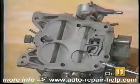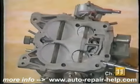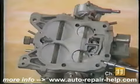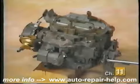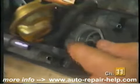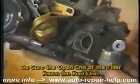Reinstall the idle mixture screws. Turn them all the way in and then back them out the same number of revolutions as counted when they were originally removed. Reinstall the choke pull-off and tighten the screws securely. Then reinstall the idle stop solenoid and the fuel filter, spring, and fitting. Be sure the open end of the fuel filter faces the fuel line.